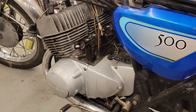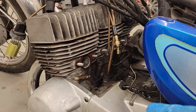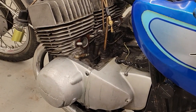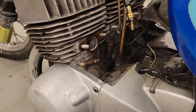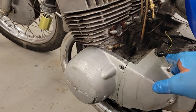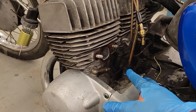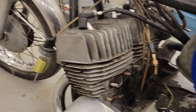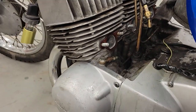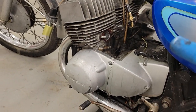So I go through my routine checks — I pull the carbs off, I pull the intake manifold off. I didn't even have to shove a dipstick down; this motor was so bad that oil was actually pooling in the intake port. There was so much oil it was almost flowing back into the carburetor. That's how bad it was — but again, that's 36 years of drip drip drip through the check valves.